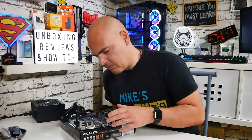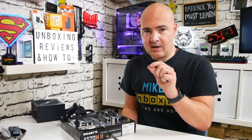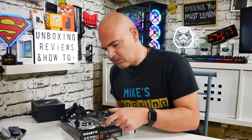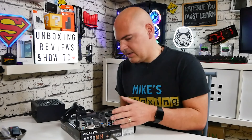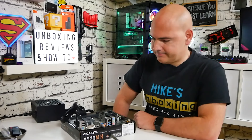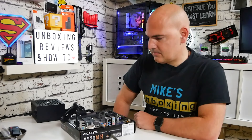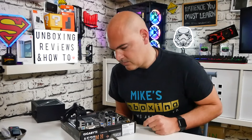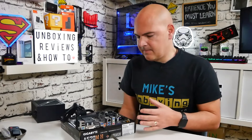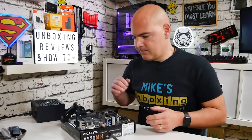You'll see the flashing LED — hopefully it's picking up on camera. If you've got your IO shield installed, there is actually a tiny little hole in the IO shield just so that LED is visible. This will continue flashing until the process is done. If the light stays on solid, that means something is wrong and it's not working. Just let it carry on — it'll flash for a while and wait for the power supply to do its thing. The key thing here is patience. Once we've got a solid LED briefly and the fan has started to spin up, the system is actively flashing. The fan spinning on the power supply is our only visual recognition that something is actually happening.